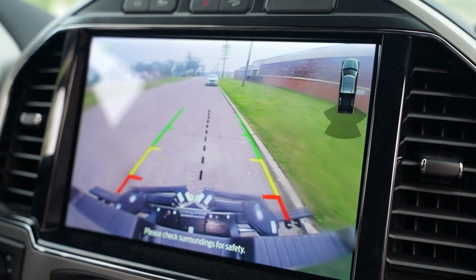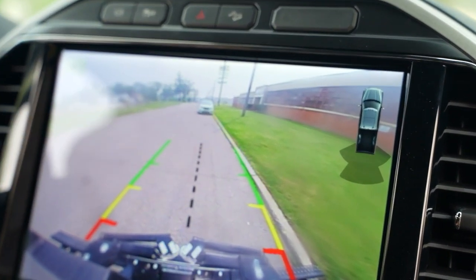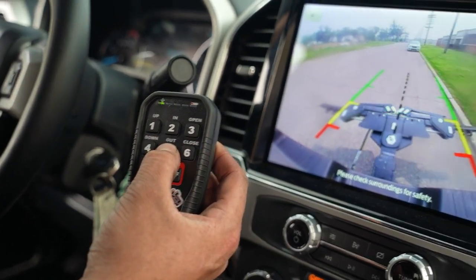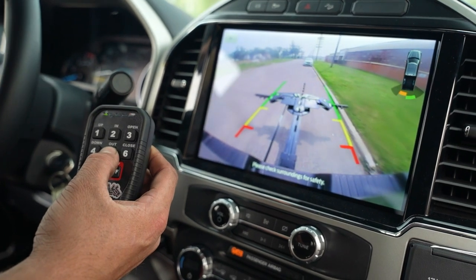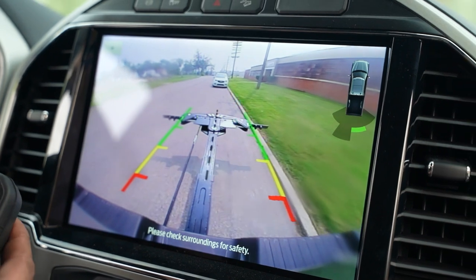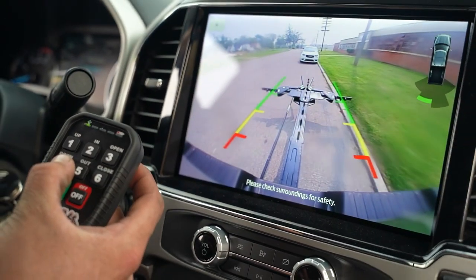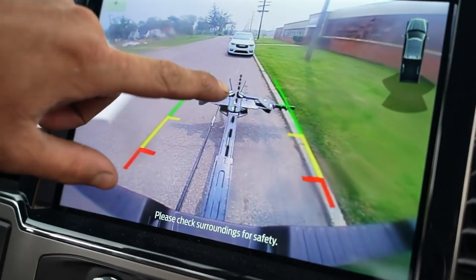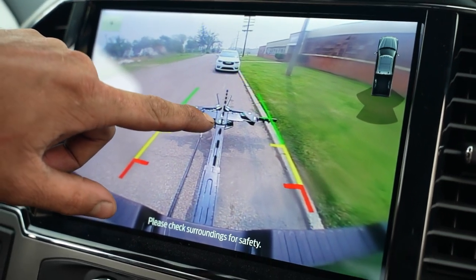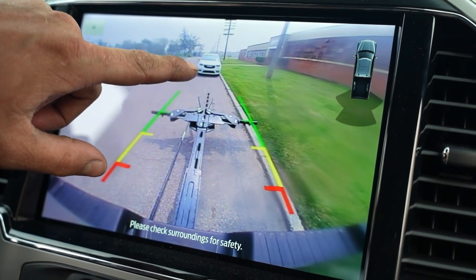The Ford's got a dotted line in the middle that tells you the center of the back of the truck, which we're looking for on the minivan as well. First step, we're going to go out with the unit and start backing up. We're going to bump close, get the arms open, and line up. If your truck doesn't have the dotted line — Chevy and Dodges do not — you can see the main hex pin, and we're going to line that up in the middle of the Chrysler emblem.